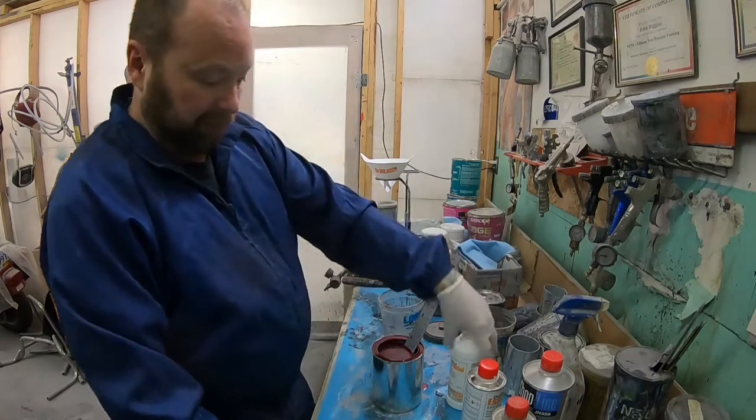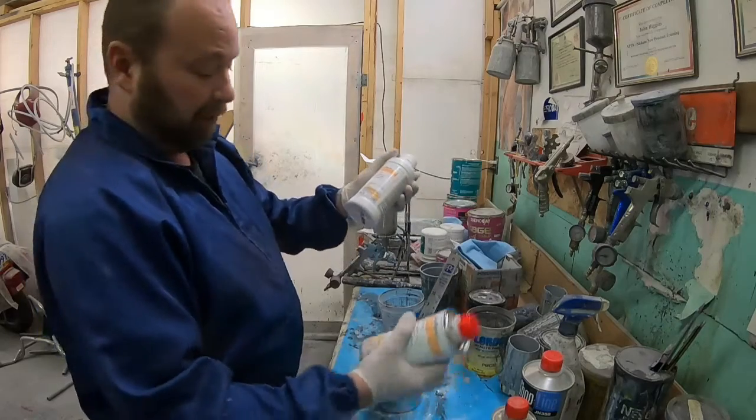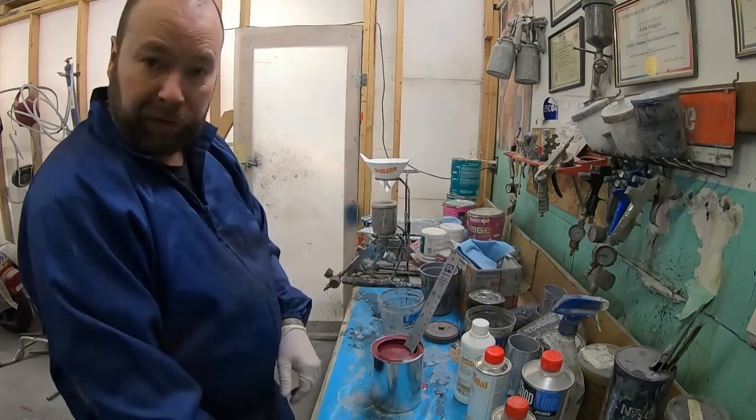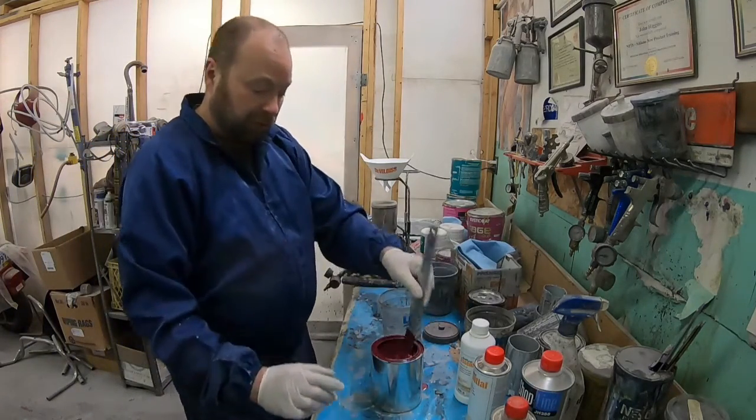So this stuff is the Dell Fleet. This is the fleet paint stuff, and this is pretty simple, 6 to 1 to 1. It's a single stage direct gloss, so we'll mix up some paint, 2 maybe 3 coats, and she'll be good to go.